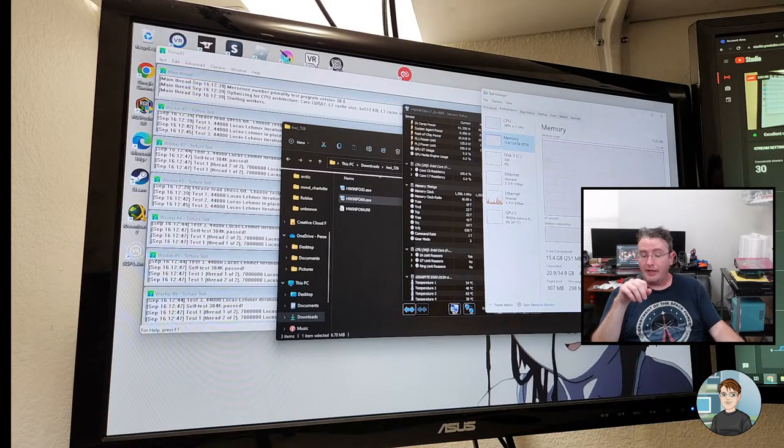And by that I mean creating yourself a USB flash drive by going to Google. You type in download Windows 10, and that will link you over to a Microsoft website where you can download an installer onto a USB flash drive for Windows 10. You run the setup.exe from inside your existing Windows 10. That will upgrade you to the latest version of Windows 10, and it may fix the problem because it will also replace the version of Windows with the new version. That would be something to try.